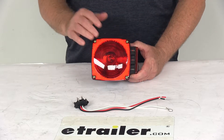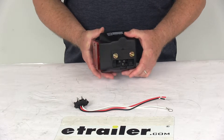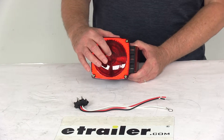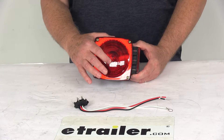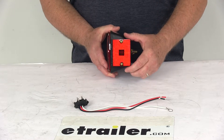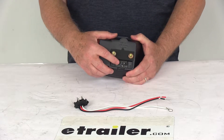I'm going to show you how those test lights operate when I hook this up. This is submersible polypropylene construction, ideal for boat trailers. They use incandescent bulbs which are easily replaceable. The main bulb is an 1157 bulb for the stop, turn, and tail lights. On the side marker it's a 193 bulb.